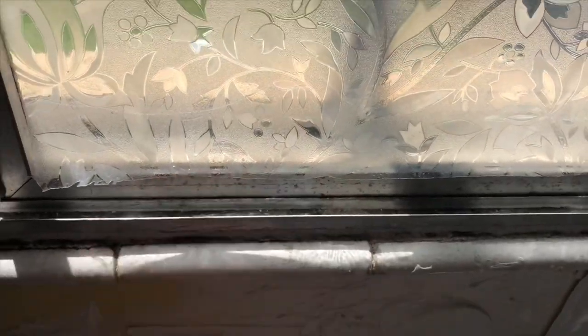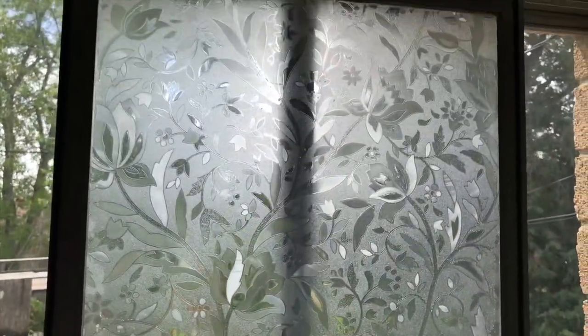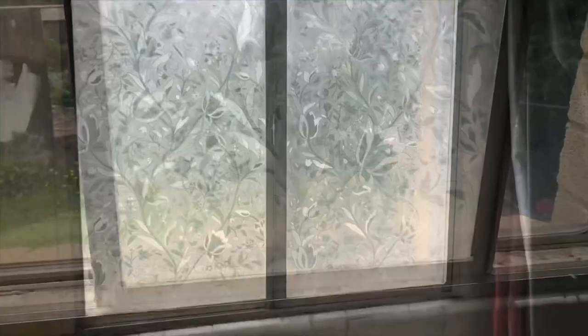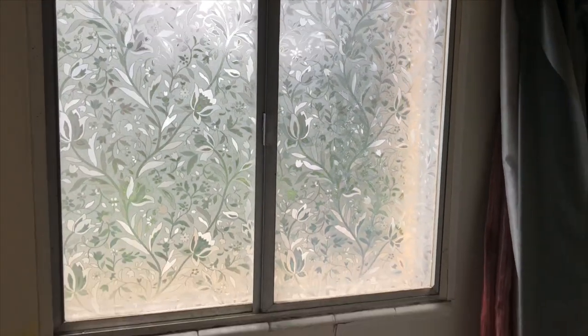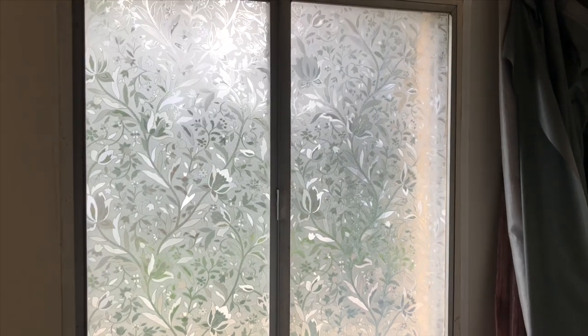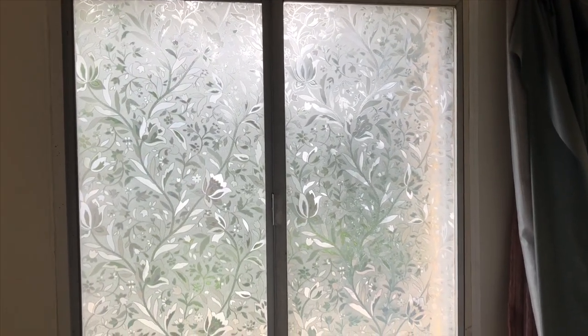You do not want anything touching the plastic or it'll cause bubbles. Leave a millimeter of gap between the rim and the window just so nothing bubbles. It should look like this and you just want to let it air dry. Piece of cake. Both windows took me roughly 35 minutes. The hardest part is the trimming — take extra care when you do that. Use new blades. Don't be afraid to use more soapy water when working the bubbles out, because that's really key.